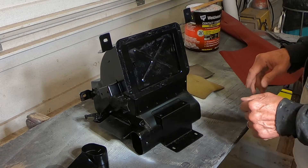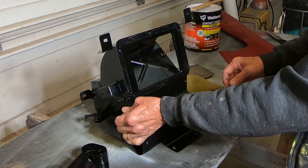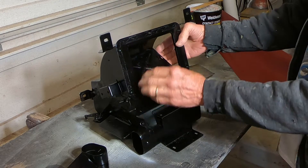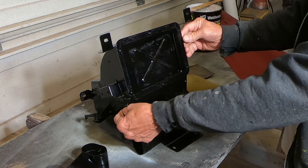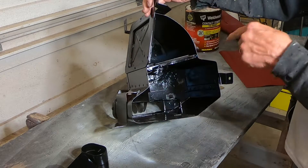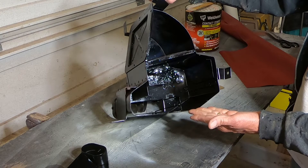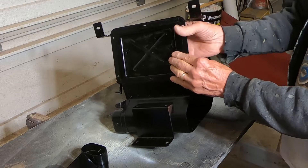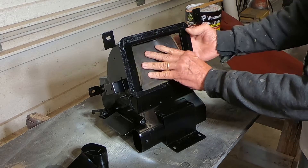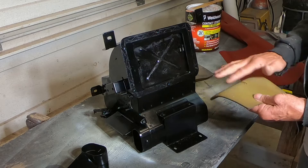The paint's dry now. I've got to do a few things before I can put the core in here. This little trap door here opens and closes the cavity for the air from the blower motor to come in. When it's closed it seals it off; when it's open it allows the blower motor - which attaches right here - to blow air down through the heater core and out these vents on either side to supply warm air to the cabin area. This little door had some thin quarter-inch foam with vinyl material on the outer skins to act like a seal, but this foam is getting pretty rotten and powdery.